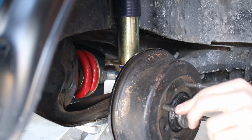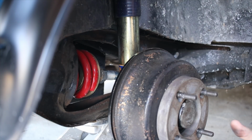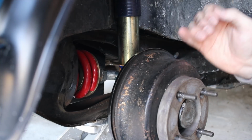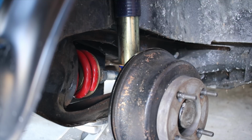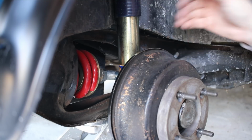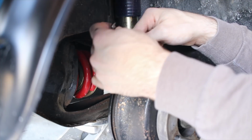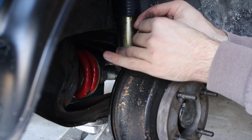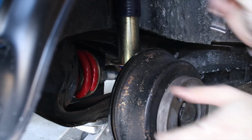Awesome. Now, there are some situations where when you reattach your wheel, this actually gets pushed down, sandwiched in there, and then it does end up engaging while you're driving. And so in that scenario, you're just going to want to loosen it back off and then loosen this on the back a little bit. And I have a sneaky suspicion that I over-tightened it a little bit, just because I've done this a few times. And so I'm going to loosen it just a hair, and that should do it.